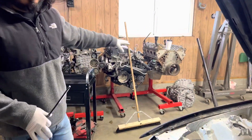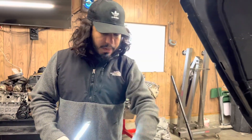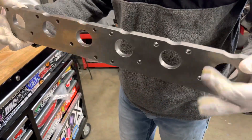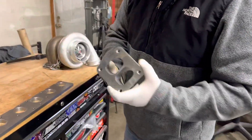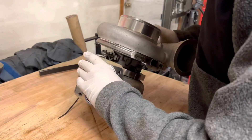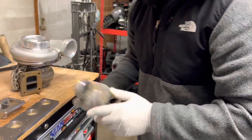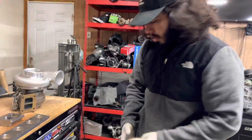I have quite a few spare engines out here where I can mock everything up and build it off-car instead of working everything with the engine still in the vehicle. Here's the head flange — this is the flange that bolts onto the exhaust side of the head — and this is my T4 divided flange that bolts straight onto the turbo. Down here I have a lot of fabrication pieces: elbows, straight tubing, and so on, all of which I'll be welding together.